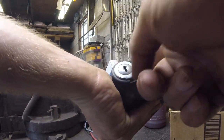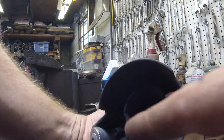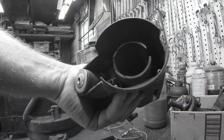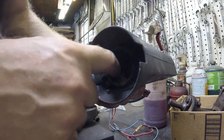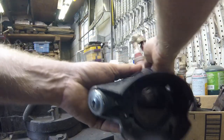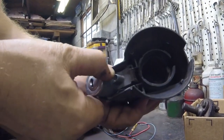Let's put this one in the stare-at-it-forever-and-realize-how-simple-it-is file. Here's my issue — need to get this entire assembly out. What I've been staring at is this entire assembly. It looks like there's a pin down here that locks onto the steering column — the steering lock as it would be — and it seems like that pin has to go in to pull this out. Well, that's not so. The very front here is a little bit beveled and this is angled. After staring at it for long enough, I realized you can just push it from behind and it comes out just like that.